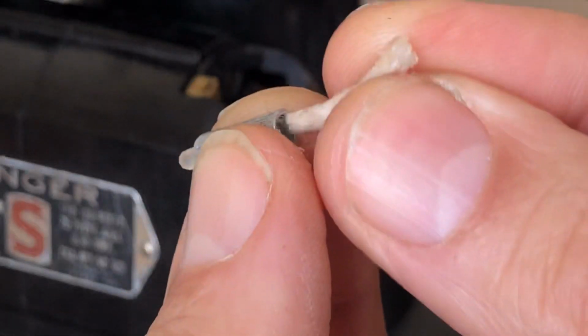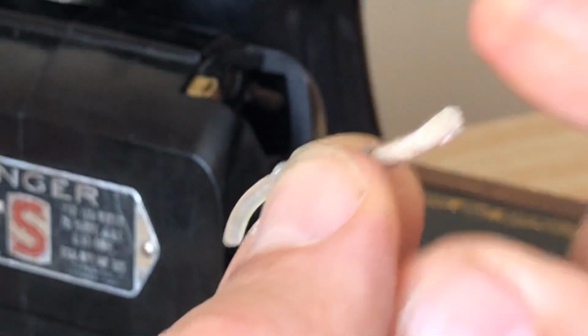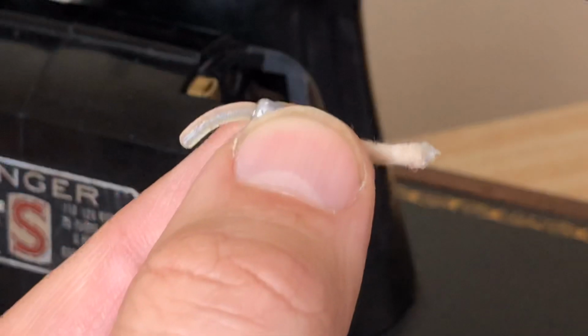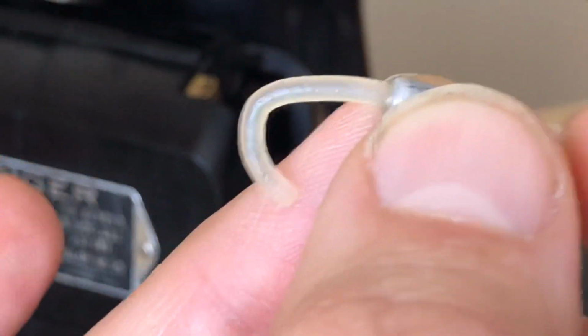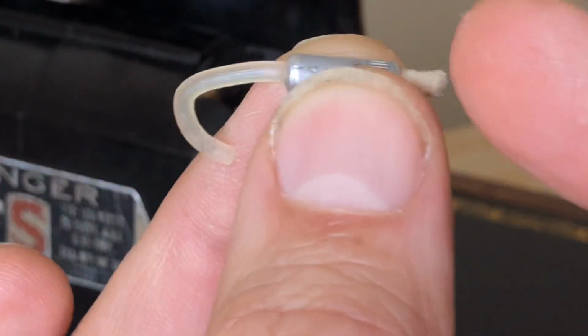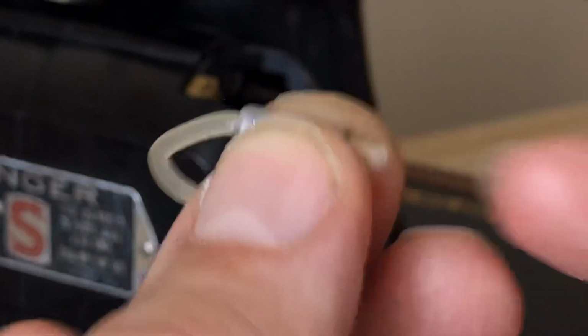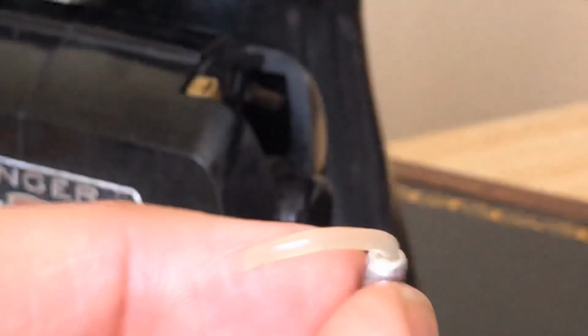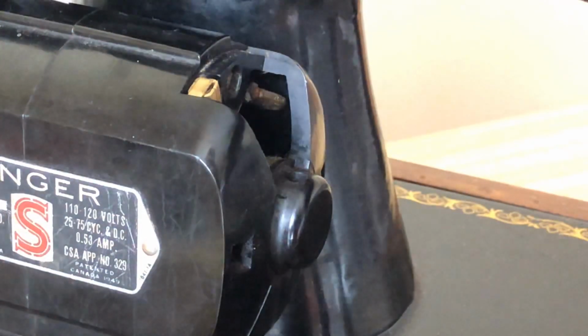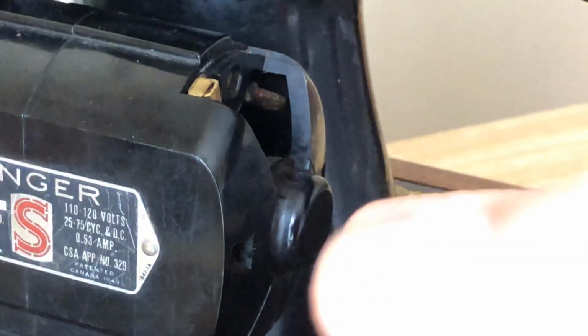You think, well, gosh, what am I going to do? I'm going to push the new wick in, okay? Some of that grease I put in is coming out, but at least I've got grease in there, right? I've got grease in the wick holder, and when I push the new wick in, it will stop, right? Because the opening on the bottom where you insert the wick is bigger around than the opening in the top. The top is just there for the grease. So we've got grease in there surrounding the wick.